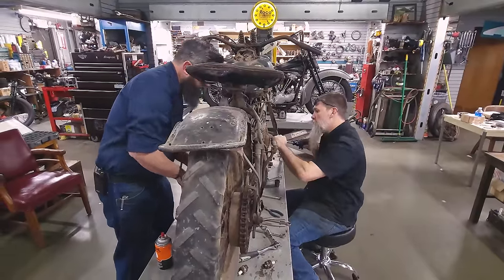There's the oil tank — big shell in there, about three and a half quarts of oil on this side, and three and a half gallons of gas in the tank. What year is it, by the way? It's a 45 WL — it's a 1945, not a '47. These are WLA cases — see the green? So these are like military surplus cases. The belly numbers say '44 — late set of WLA replacement cases. They made 70-80,000 motorcycles and even more spare parts, so for years guys would replace stuff using those old military parts.